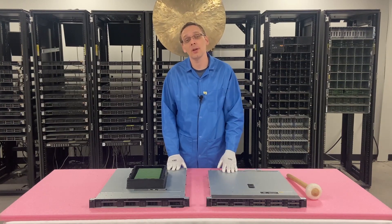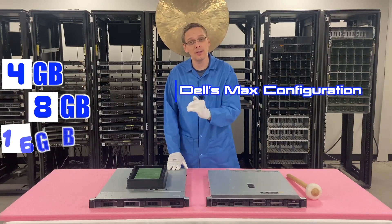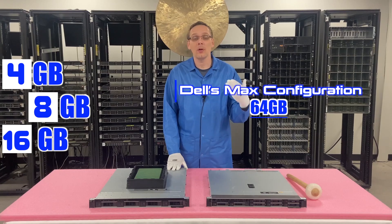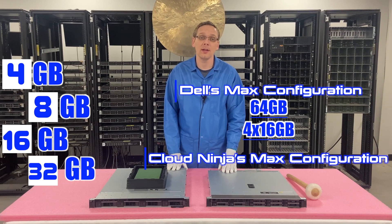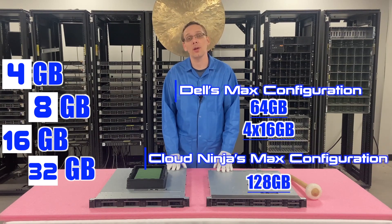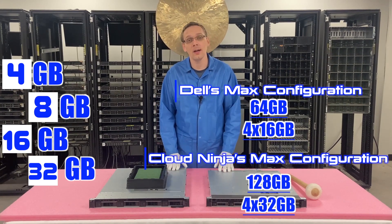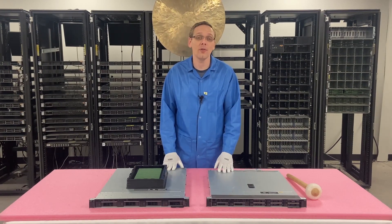They will clock down. As far as the different sizes, Dell will tell you that you can use 4GB, 8GB, or 16GB and the max is 64GB overall. However, we've actually played around and yes, those all work — 4GB, 8GB, and 16GB — but you can also put in 32GB. Again, make sure you have updated BIOS. With 32GB you can max out the R340 at 128GB using four 32GB modules at 2666 speed. Now that we know a little bit more about the DIMM sizes, DIMM speeds, and how you can max it out, let's go ahead and actually install them.